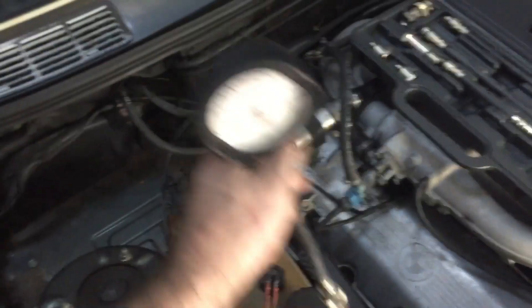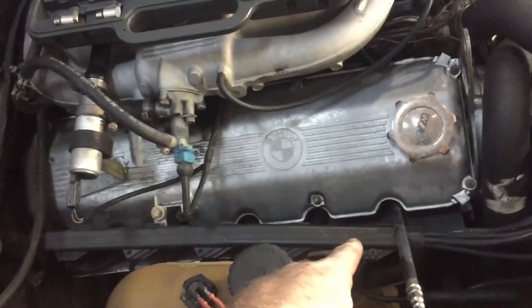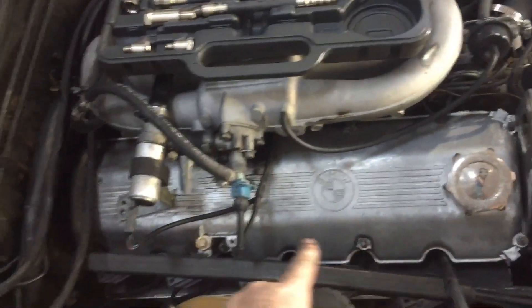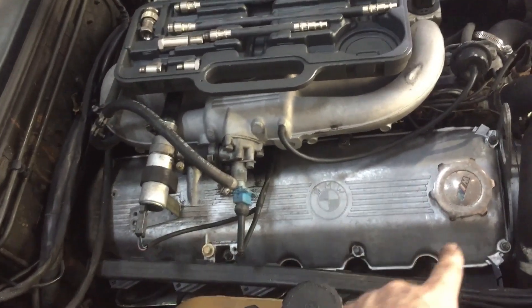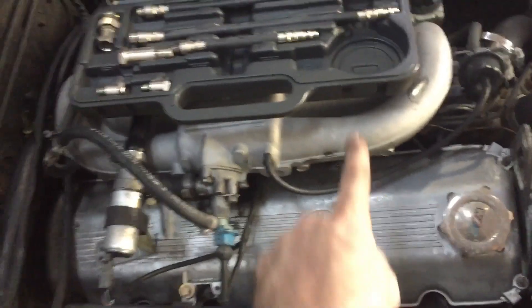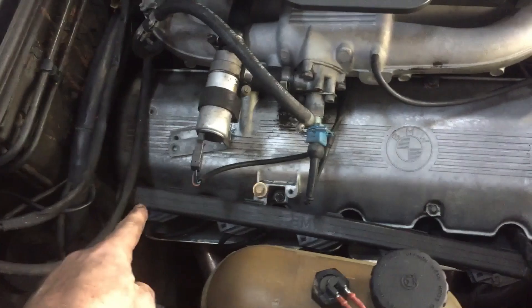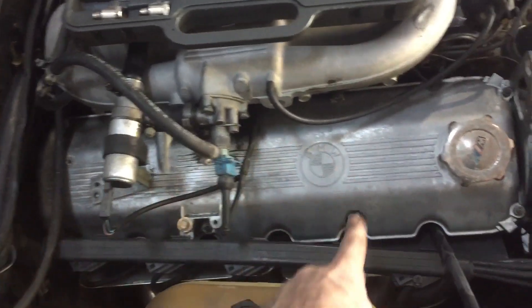Okay, cylinder three. Okay, cylinder four. I write them all down. Hopefully they're all around the same. Then I check the schematics in the book or online to see what PSI I'm supposed to have for my rings inside here for my piston. So if I'm supposed to have 115 to 125, and let's say I have 120, 120, 80, 120, 120, 120 — so all these are within spec except this one.